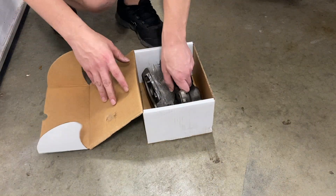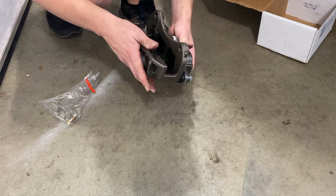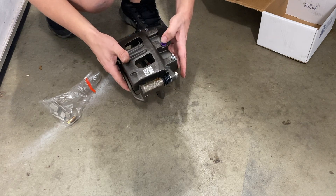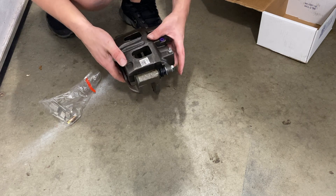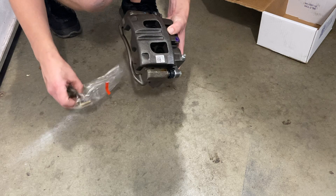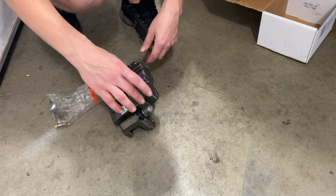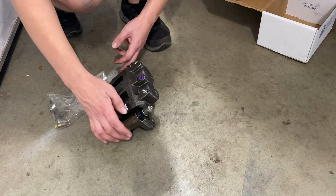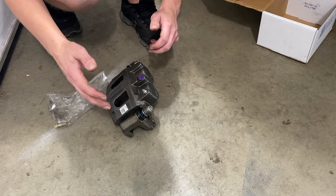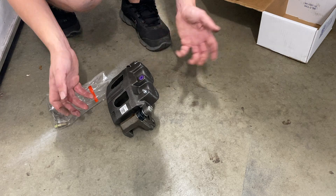So this is the brake caliper. Like I said, it's a loaded brake caliper. The way you know it's loaded is by it having the brake caliper bracket included — that's how they determine loaded versus unloaded. It comes with everything we need: two bolts, a bleeder screw, and it supplies the banjo bolt with two new copper washers and some new shims. So we're going to loosen up these two bolts, put the new shims in, lube up the brake pads, and put the pads into the caliper. They're brand new pads — still really good.